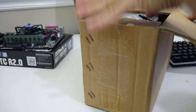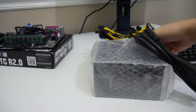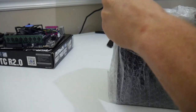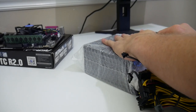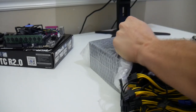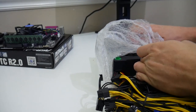There's a very nice BTC power supply on Amazon that allows for expandability — it's one of those Chinese ones that reads 'Bitcoin mining power supply' on the side. It will go up to eight GPUs. For this particular build, the model that goes up to six will be just fine. Alternatively you can pick up a Seasonic 1300 watt power supply, which I've used in a lot of rigs and will power up to seven GPUs depending on how much power you're pulling.